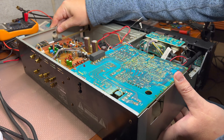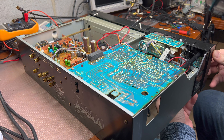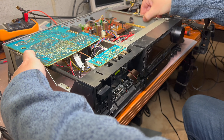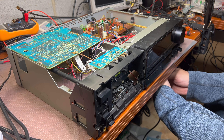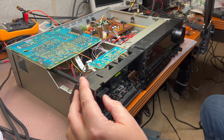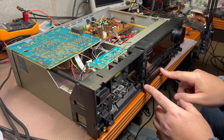Door opening. Maybe it's the wrong position of the tape transport, so it would not allow the door to open. Now let's turn it on and see if it will settle into the proper position itself. Let's get into playback mode and see if it's there.